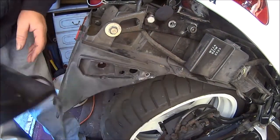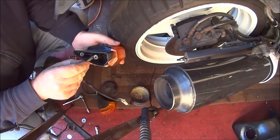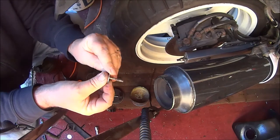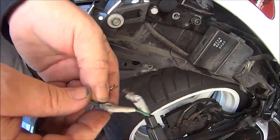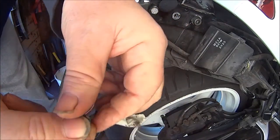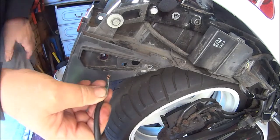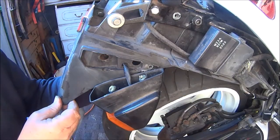You can put this one back on - these are the bolts for that one and I'm going to dip them in the grease, put some grease on them. These are eight millimeter bolts with six millimeter threads. I'll put a big washer on it. Just to show you how some people do things - just twist the wires together and put some tape on it. That's how your bike catches on fire. Thread your wire through the middle hole.